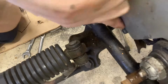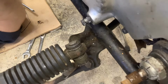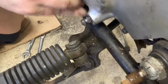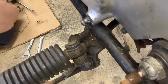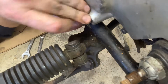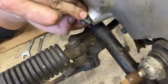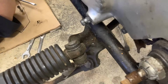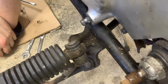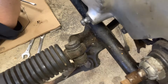Shifter is off. And that really exposes these two bolts we've got to take off. So let's see if we're super, super lucky here. And look, see how this works. That slipped on there, and this bolt actually goes right into that groove, and that holds that on, and then it crimps onto that shifter. So we don't want to lose those bolts. We want to keep those together with everything else. So let's see if we have just as good luck with these other two bolts.